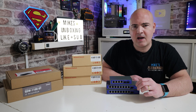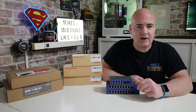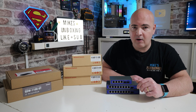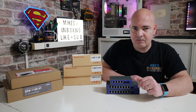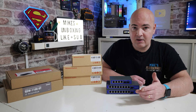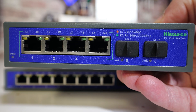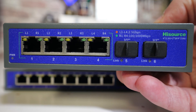Some people, if you're lucky enough to live in certain areas in the UK, may be offered new broadband packages from various suppliers including Virgin Media, which are now offering a 2 gigabit connection. This means if you have the older 1 gig network, you're going to be limited by your switches and potentially by your devices inside your PC. If you've got a relatively new motherboard with 2.5 gig ethernet you're pretty much okay for the PC, but you're still going to be limited by the switches. That's why today we're looking at some extremely cost-effective devices to improve network performance in your home.